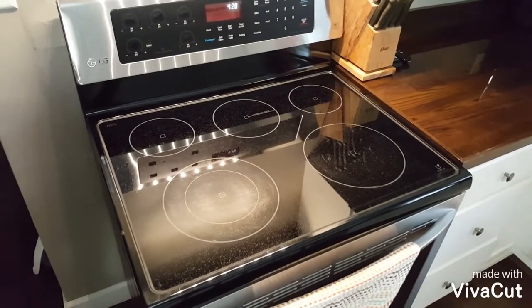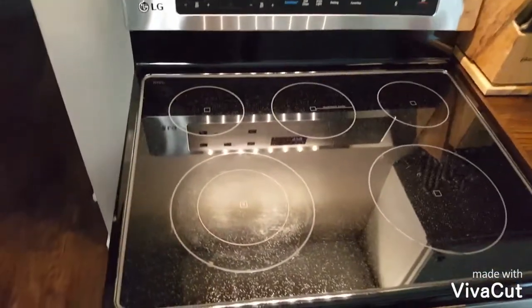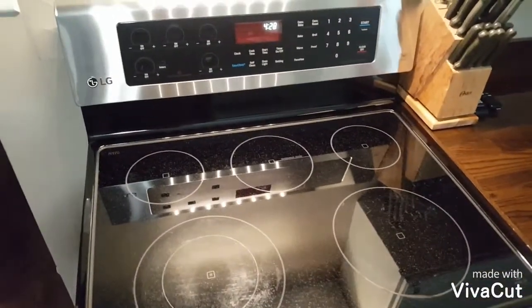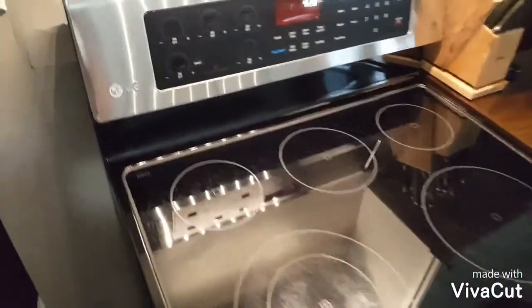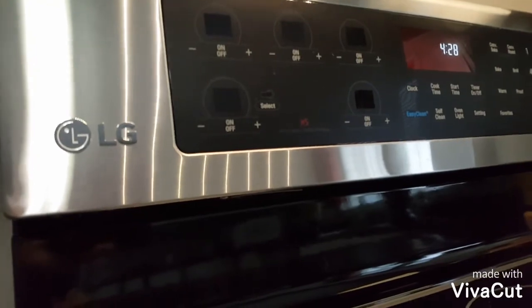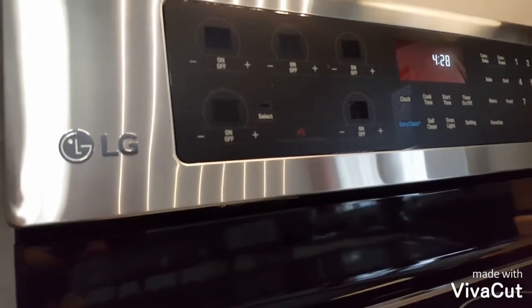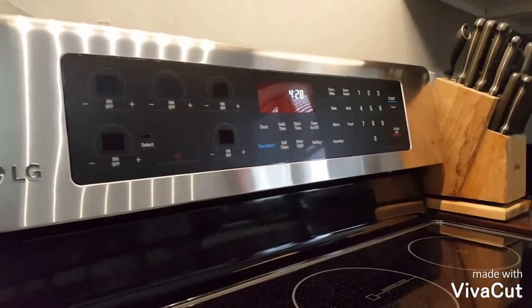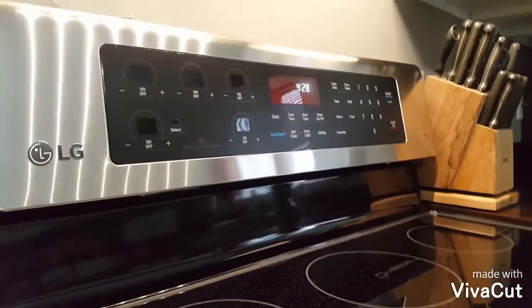Started doing my own Googling, and everybody seems to have problems with the left side burners first. Then they start getting the other things, just like we did. Well, what I've come to understand is that this vent tube in the back right here, it's where all your excess heat from the stove comes out. You see it's right underneath the control board for the left side burners. It's kind of a no-brainer what's going on, huh? All the electronics get baked, and it only took 5 years.